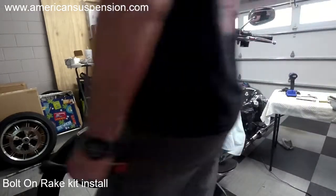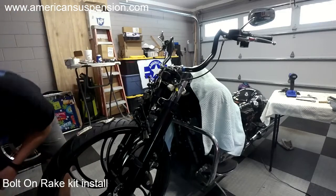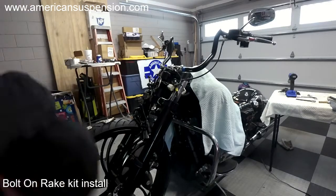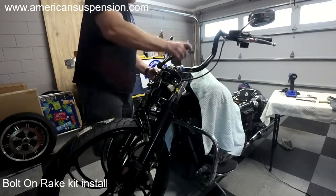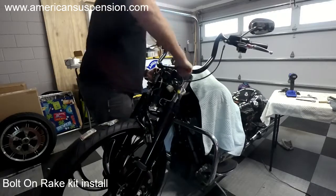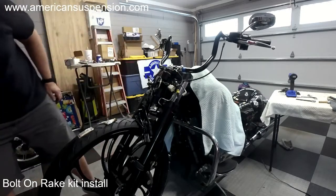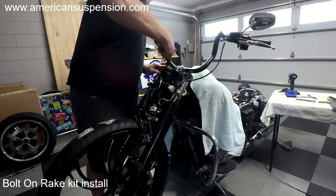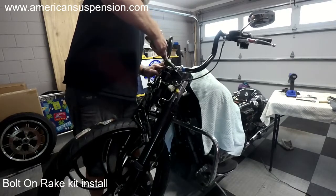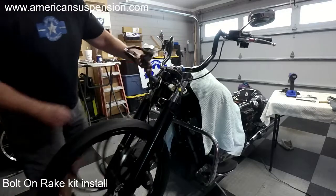Now we're going to tighten this front pinch bolt to the tree, and then tighten up the second nut against the top nut. Again, 35, 40 foot-pounds. Now, I don't have two wrenches. You probably aren't going to have two wrenches, but you need to just snug this one up and not turn the next one under it. Again, snug, just a little bit of firmness. Check your swing again. Still looks great. All right. Spin the wheel. Wheel looks great.